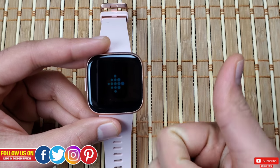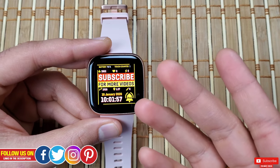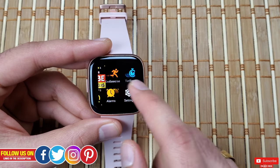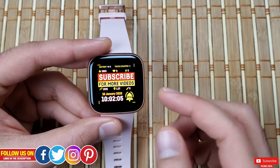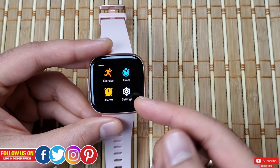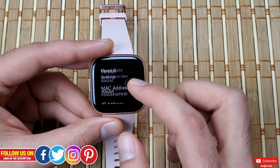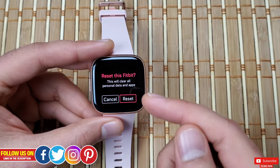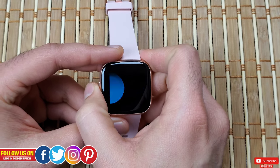Let me explain what just happened — this whole thing is also called a soft reset. What it basically does is kill all background processes, close all apps and background functions, so when the watch starts it's a completely fresh start. Most probably, just doing this should be enough to get the watch back up and working fine. But if you have a faulty app or process that keeps freezing your watch every time it turns on, then once the watch turns on, go straight to Settings and factory reset your watch so the faulty process or app is permanently removed — and that should fix the issue.